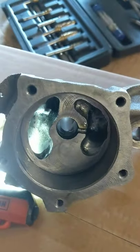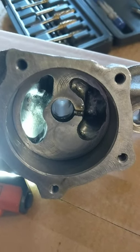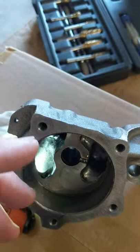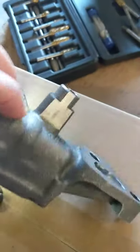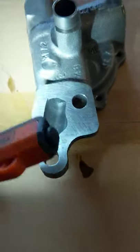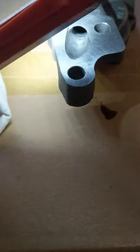After I ported it, I went over everything with 220 sandpaper, and also the gears, the rotor in there — took some 220, rounded all the sharp edges, and I drilled this out two sizes bigger and ported that as well. And it is smooth all the way through.